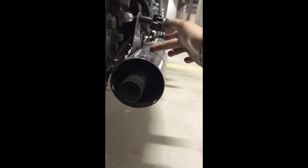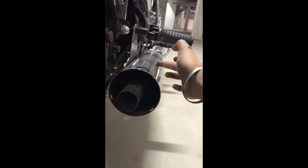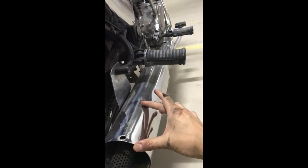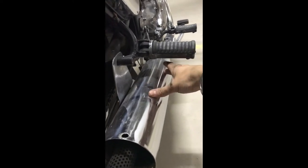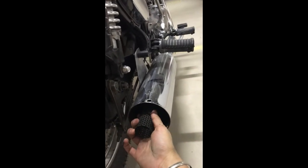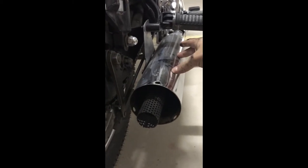Now the problem I am facing is there is a wall here which is welded, and the only access I am getting is only up to this wall, which is approximately 4 inches. I am not sure what lies further in here, so probably I will have to open the entire silencer from that point. I am not able to pull this thing out - it seems it has been welded to something inside.